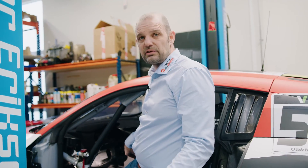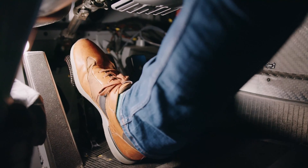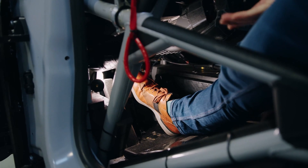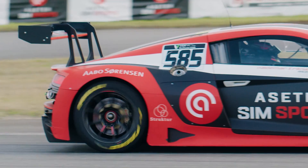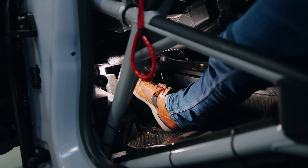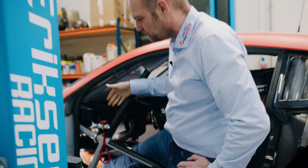Let's move to a race car. This is an Audi R8 GT3 race car, and I'm now pushing the brake pedal. You can see I can move the pedal about one to two centimeters and then it becomes rock hard — exactly the same reason as in the go-kart. There is some play in the system and the caliper pistons have to travel to the brake discs, which translates into that one to two centimeters of travel. But then I'm pushing all my force against the fluid, which cannot be compressed, and the brake pedal is rock hard — exactly as any race car driver would want it.